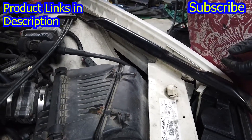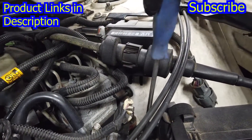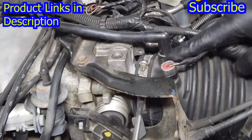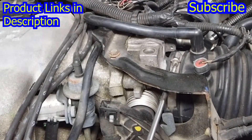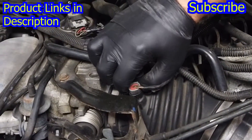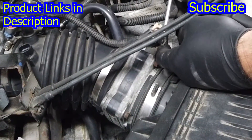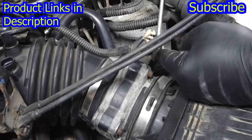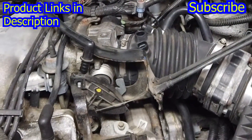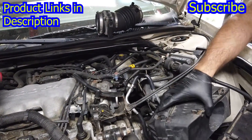We're gonna go ahead and take the air box off. We're going to loosen up the tubing here. We're going to take out the temperature sensor, which is just a tab. This is your mass airflow — good time to check all this stuff, make sure it's clean, by the way. It's just a nice little tab — we don't want to break it, just want to get it up, and there she goes. Then we've got the breather tube right here — let's go ahead and move that. Should be able to just slide it off, and there she goes. Now this is just coming out as one piece.